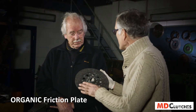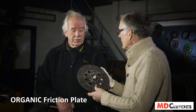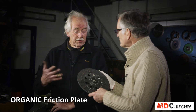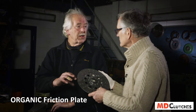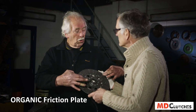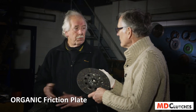I had a problem with ripping the material off. In excessive situations where you don't have a flat flywheel and a flat pressure plate, the clutch plate is only held on the very outside, so you're not using all the width of the material. The material won't take it and it'll just rip off.